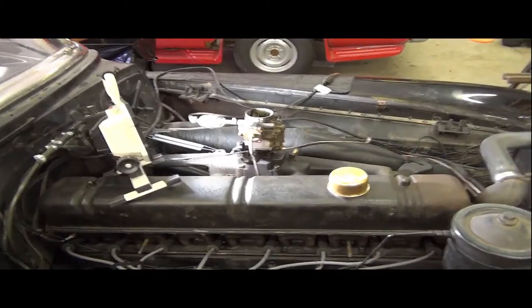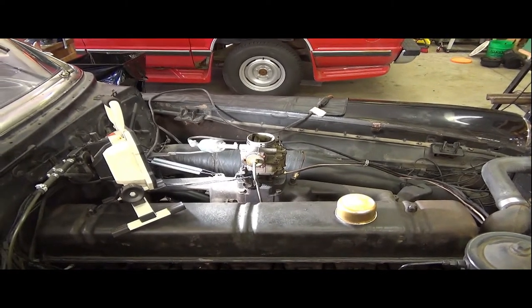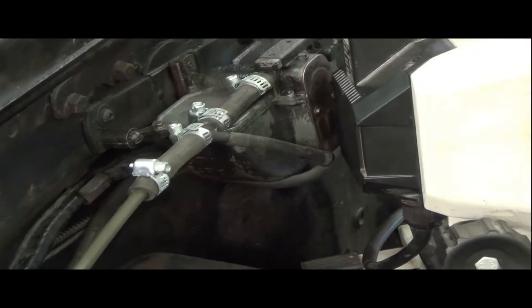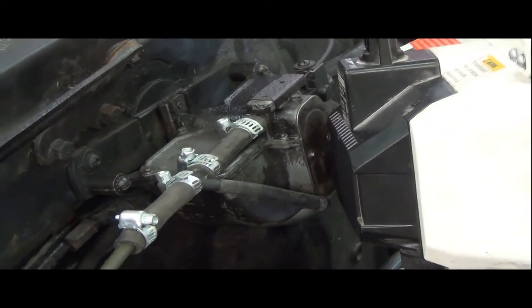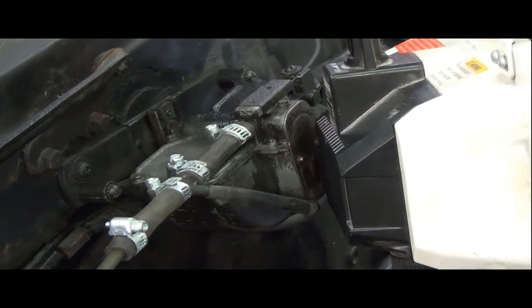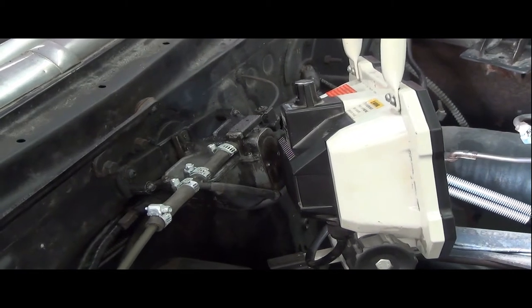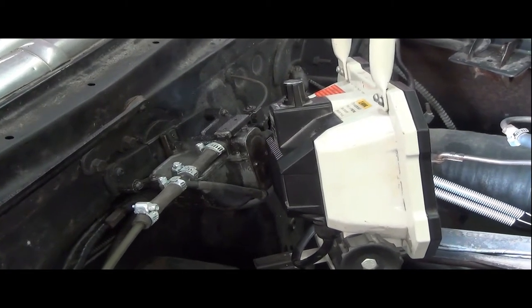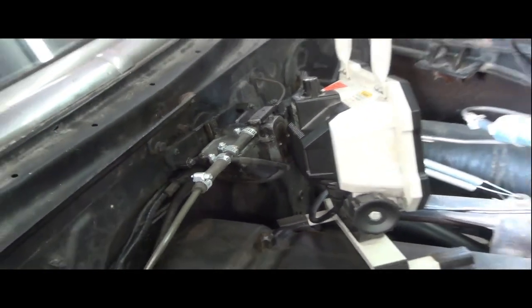All right, it's a new day with new enthusiasm to attack some things here. So, I've regrouped. Let's look at that wiper motor right there, the one that wasn't working. I found out that those little rivet guys, I thought they were rivets, they're not rivets. They actually are screws, little bitty weird oval head shaped screws only used on these little Trico motors. If you scrub them hard, you can fashion a screwdriver that'll get over those heads, and supposedly they will unscrew. So by golly, I'm going to take another crack at that thing sometime here in a little bit. And I'll take a measurement on that jar, and I'm still going to be on the hunt for a different jar. So we'll come back to that later.